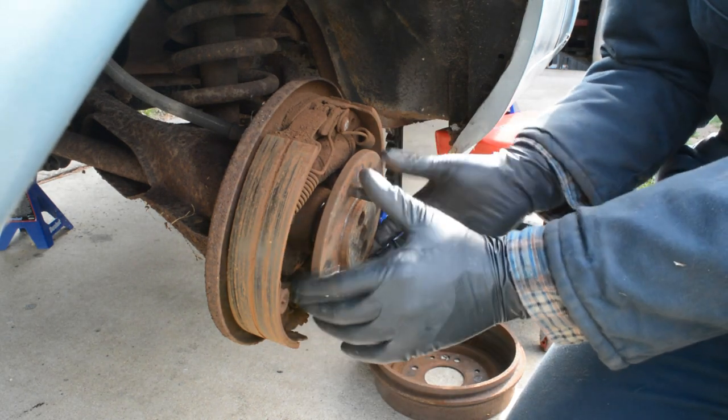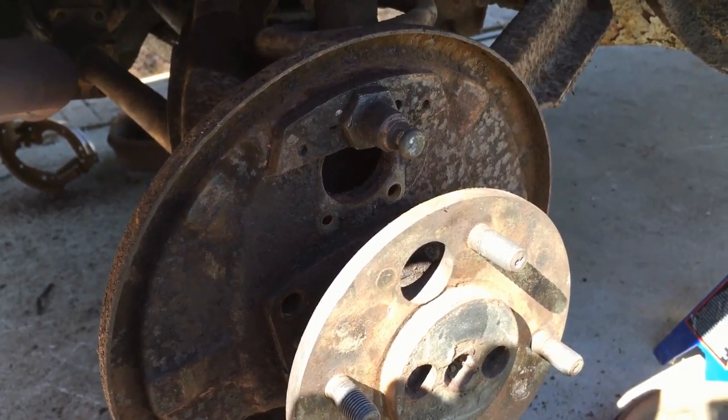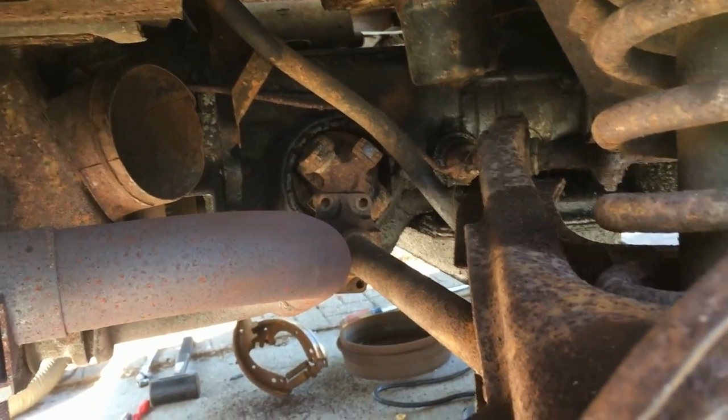Despite the brakes looking good initially, things were about to go sour. To get the wheel cylinders out of the back, you've actually got to kind of move the axle out a little bit. So I had to undo the axle at the transmission, and then I had to slide this out to be able to get access behind. There's two little nuts just buried in there. You can't even see them. Well, you can kind of see them enough to know you can't get to them.